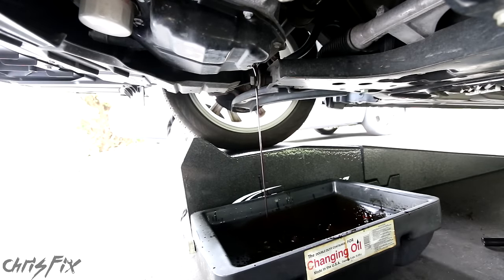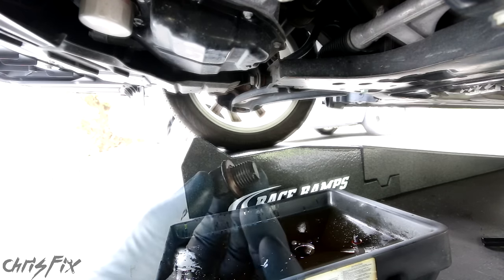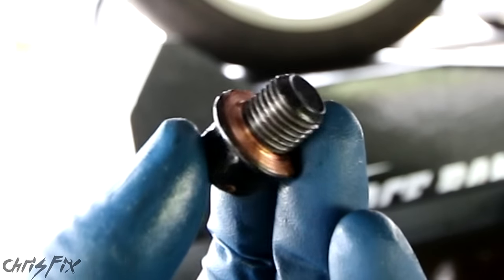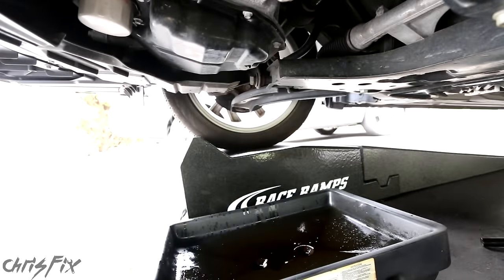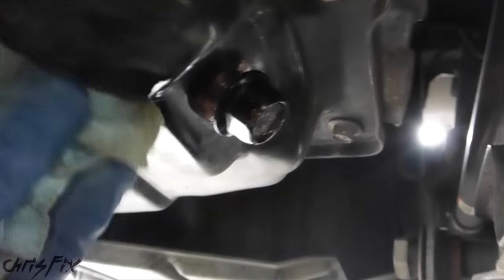Once it gets really loose, make sure your drain pan is ready to go and loosen it by hand. Now you can wait for all the oil to drain out. Some people say you should change your oil after running the car for about 10 minutes so the oil is warm and flows easier — in reality it doesn't matter. If you change the oil cold, all that oil will be in the oil pan and you won't risk burning yourself. On some oil drain plugs there's a gasket to help seal the plug — here there's a copper crush gasket. These gaskets are generally one-time use, so replace the old gasket with a new one, though some people reuse them once or twice without leaks.